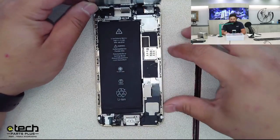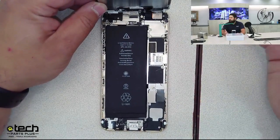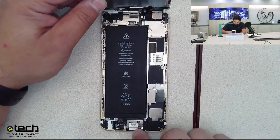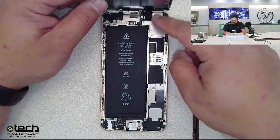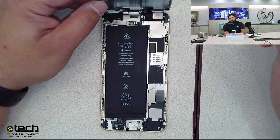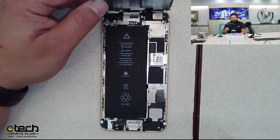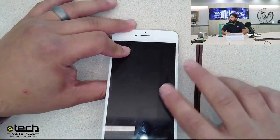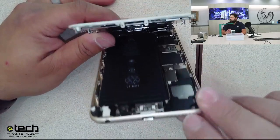So when you open the phone, the first thing you want to look for is obviously signs of liquid. This one, it was in there for a couple seconds. I see some near my charging port and near the top end. Liquid is typically going to go into what we call water ingress points, or openings in the phone where water can easily seep through. That's usually going to be your earpiece speaker mesh, your speaker openings on the bottom, and your charging port.